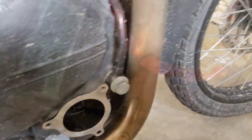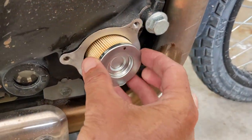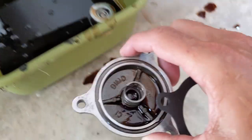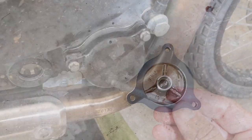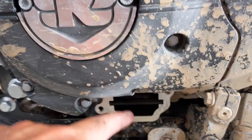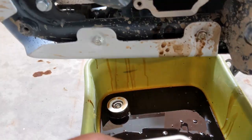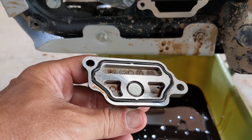If this thing doesn't run, that's the first thing I'll check. There is the new oil filter — let's get that hot rod in there. Here's the cover. Look how dark that oil is — it was bright red when I put it in originally. I'll get this installed and get back to y'all. The thing with the installing is there are two short bolts and one long one, and the long one goes in the very bottom slot. That's where I drain the oil out of. There's a little screen in there and I did pull that out, clean it, and it looked absolutely fine — absolutely clear. There's a little O-ring in there to seal it, and I'll wipe these all up real well and then put it all back together.